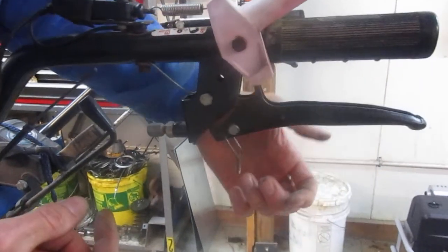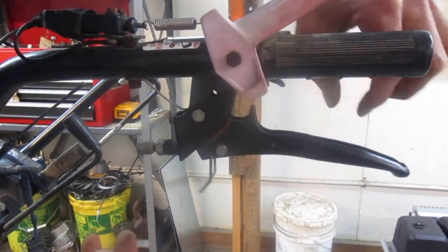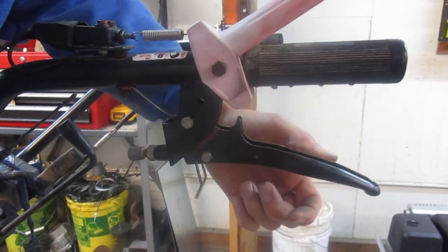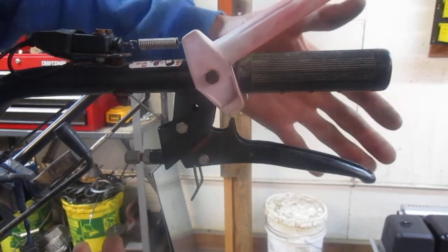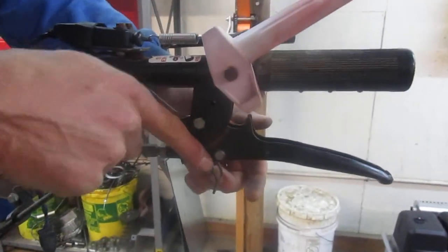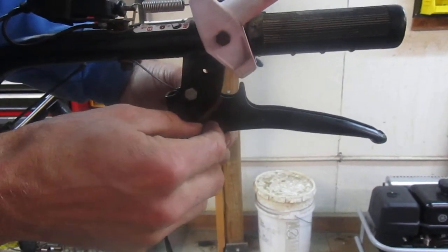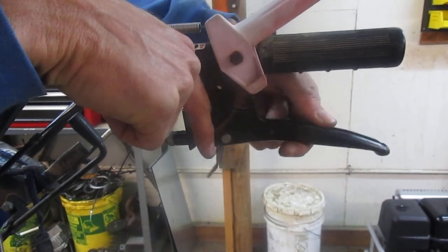The idea of the spring is to gently take the slack out of the clutch cable so that you don't have to reach down so far when you grab the handle — it kind of gently pulls up whatever little bit of slack is in the cable, to make it easier on you. That spring is actually pushing on that pin internally; you can't see it from the outside, but the other end of the spring is pushing back on that pin, and that's what's pushing the handle up.